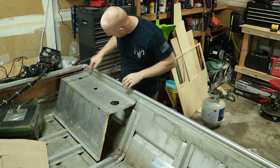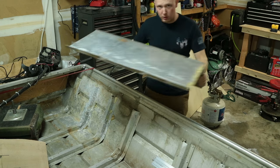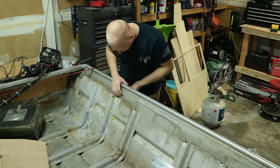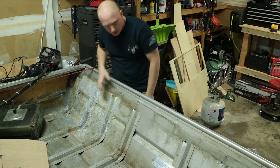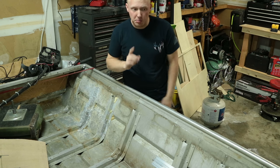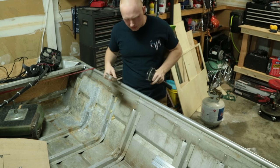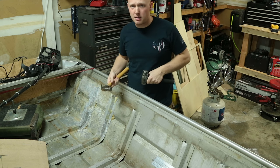So I've taken that chisel and hit each of the rivets. Just remove your seat or whatever is riveted to it. Once you remove these, some of them might be loose. I got pretty lucky this time where none of these rivets are loose, so they're probably not going to leak any water. What I'm going to do is smash these down so they don't have sharp edges on them — and this is also the same way that you tighten up a rivet.